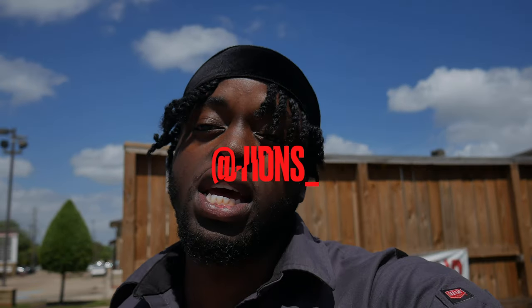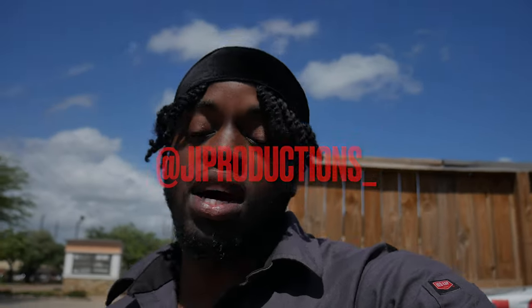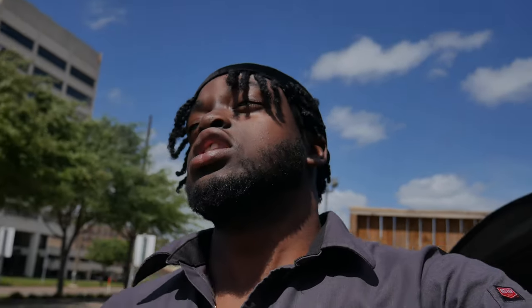Yo, what is good J.I. Squad, and welcome back to yet again another episode of J.I. Productions. It's your boy J.I., and I'm back at it again with another banger video. As you guys can tell by the title and the thumbnail, we will be working on Vader today. We're actually gonna be swapping my stock 190 or 195 degree thermostat for the Summit Racing 160 degree thermostat. This should help us with our IATs at the drag strip, keeping the car cool and allowing the fans to turn on faster. As you guys know, if you've seen the last track day vlog, the IATs on the car were super high, so the car started pulling mad timing — so much so that we were running 11.9 and 12.0s at the track.